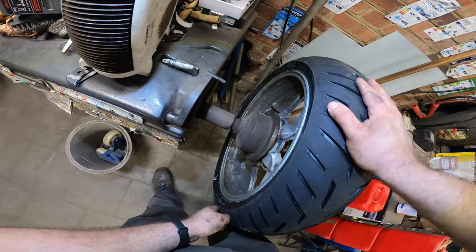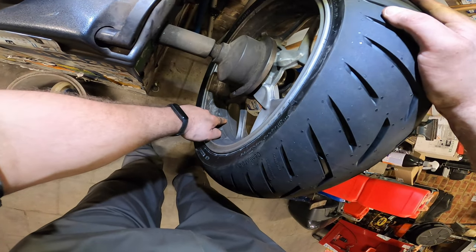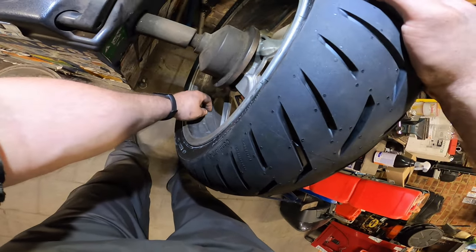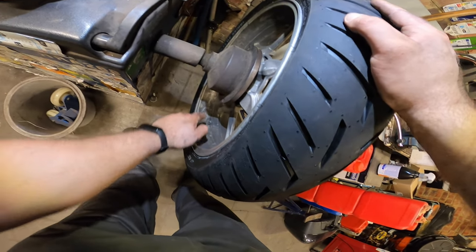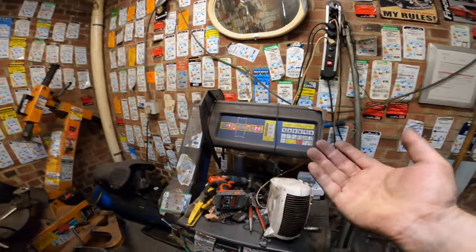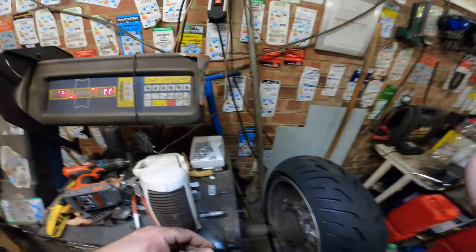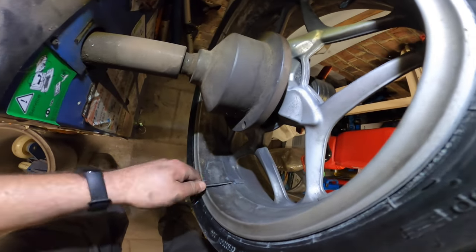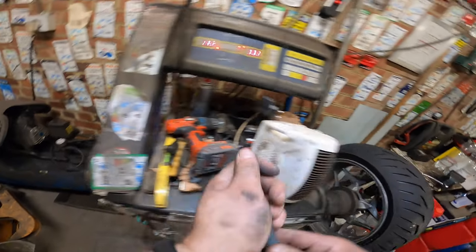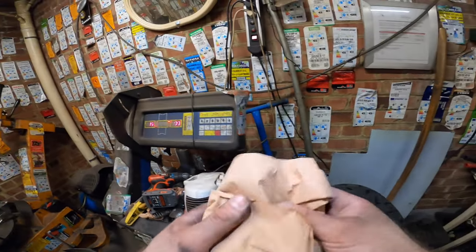We are gonna check it out, and there used to be a weight on there, and it fell off. So I'm gonna clean it. This is 5 grams, by the way. So I'm gonna clean it, take this one off, and put on 20 grams. Yep, this is 20 grams, as you can see. And let's take it off. So, little screwdriver to lift it a little bit. Hoppa. And then we'll need some brake cleaner.